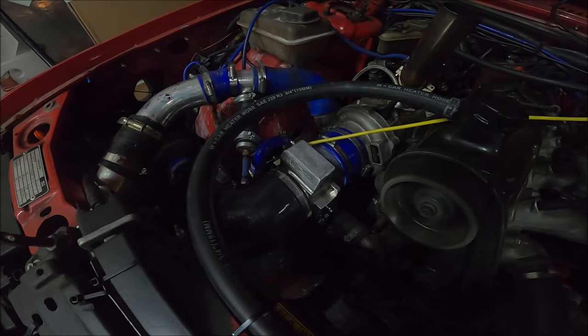Especially people who worry when, say it's a 4-cylinder and all 4 cylinders are reading lower than the factory, but they're all within a few percent of each other. It's like, so? Who cares? That's not a problem. The likelihood of all of them being similar compression but similarly low, and there being an actual problem, is very, very remote. If they're within about 10% of each other, then I would say there's nothing broken. So just enjoy your cars. Don't worry about it so much.